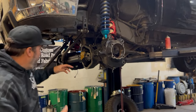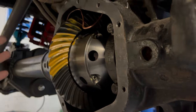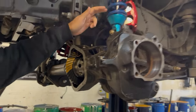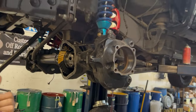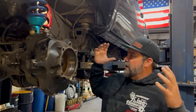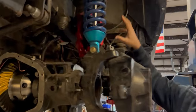The reason it's in here is Blake just went ahead and put an ARB in it. We kept the factory 3.73 gears because this truck only has 35s. We went ahead and put new ball joints in the '05 and up Super Duty axle, and we're also going to put in new unit bearings. This really gives us a good look at our solid axle kit in a vehicle — all the IFS is obviously cut off the frame.